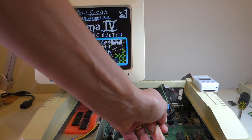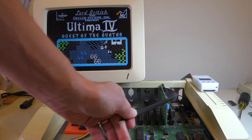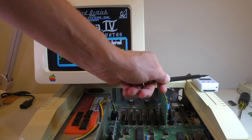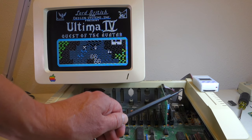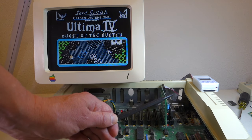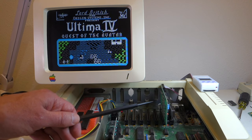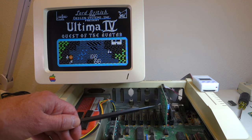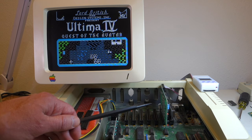The Soft SP card, since it emulates a SmartPort device, actually works with any sort of SmartPort drive — not just the W-Drive from Kaboo. You can also use it with any SmartPort hard drive or the Floppy Emu. You can even use it with a 3.5 inch UniDisk 3.5, although Kaboo warns that you need to use a special adapter because that UniDisk isn't compatible with the normal DB-19 pins.